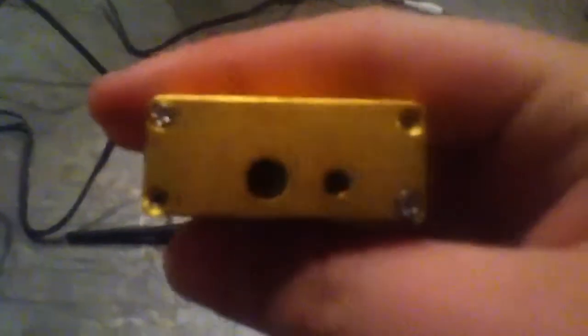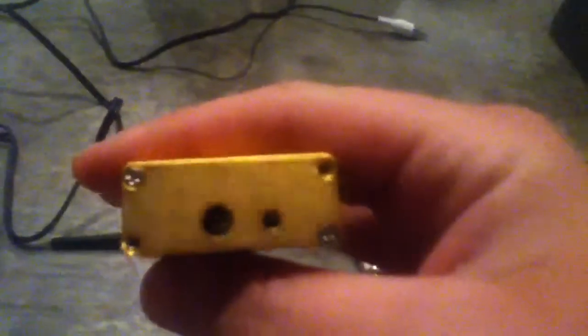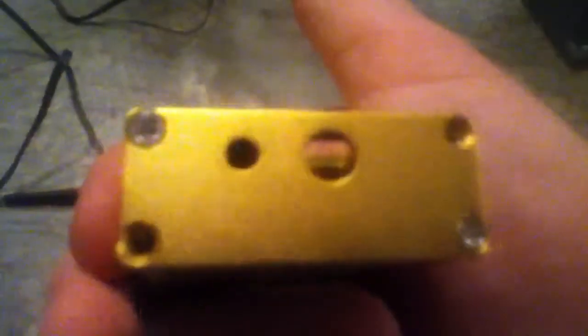To remove the case, you'll see there are four screws here and four screws up top — take all eight out. Inside there are metal plates; one is bent, so squeeze them down and the transmitter slides right out.